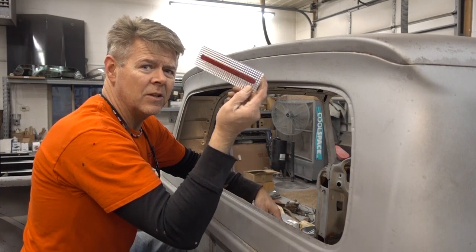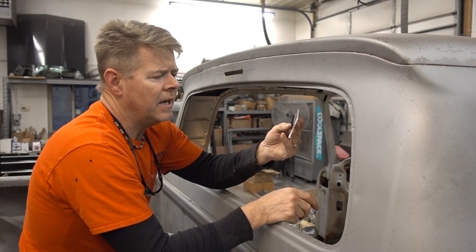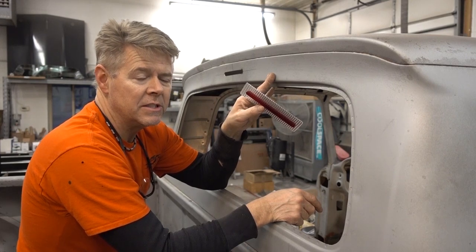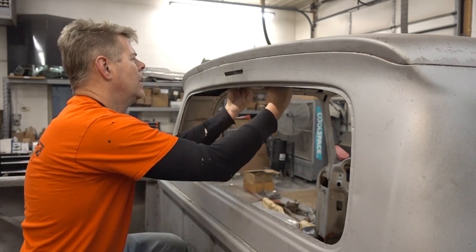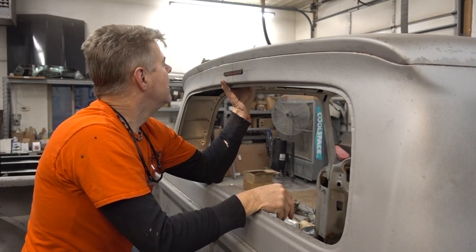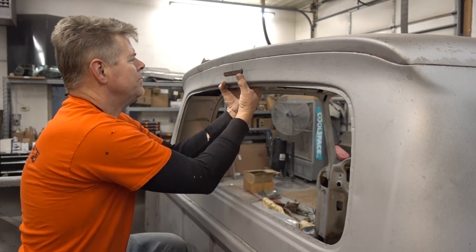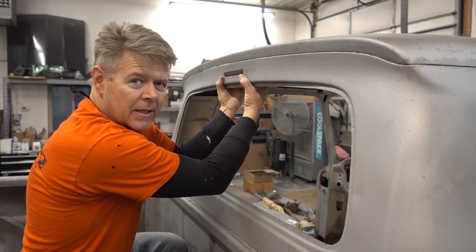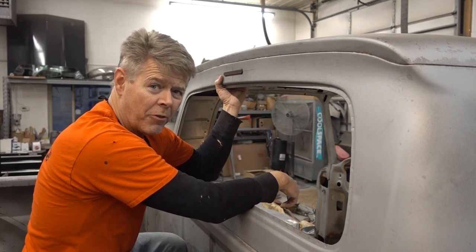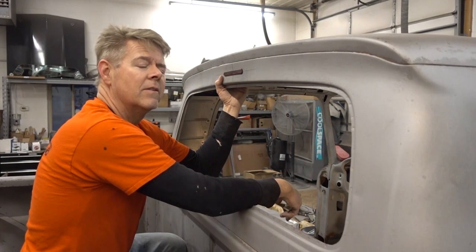It looks as if we might have been successful. This piece is meant to be ground down to shape right along with the body — whatever curvature you have. It's quite thick, so you grind it down and repolish it so it looks like part of the painted truck versus an added-on third brake light. That was in one take. I saved myself a lot of time — not needing to cut this out and weld it in. There's one small area I just have to clean up. It's perfect — I got lucky. First time we've ever put in a third brake light; normally that's on newer cars, but this client wanted one.